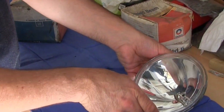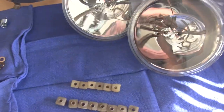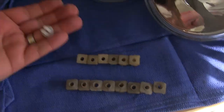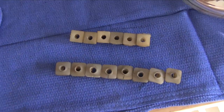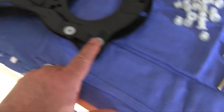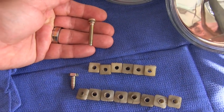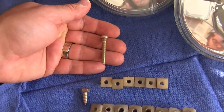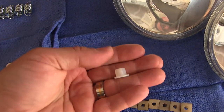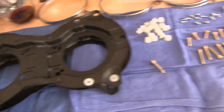Brand new GE aircraft landing lights — they're L4522s. One thing I'm noticing from my disassembly videos is that there are two different sizes of plastic clips. The large one mates up with sheet metal type screws that hold the entire buckets to the front end of the car. The smaller ones — there are six on each bucket — are held on by long threaded screws and are part of the aiming of the headlight. I only bought one size when shopping, so I'm going to find out pretty quick if it matters as I put this back together.